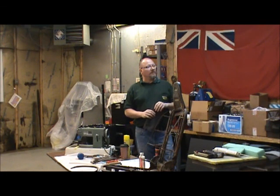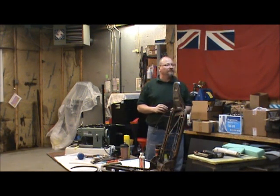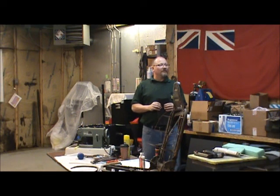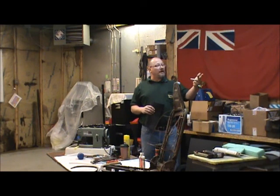But any of those, the panel bonding adhesive and the 3M 1300, it's like a once and done deal. So you want to make sure that you have all your ducks in a row before you glue that stuff, because it's going to be a real pain to get it apart. And that panel bonding sealant, that's like a two-part epoxy, right? Yeah, it's a resin and a hardener.